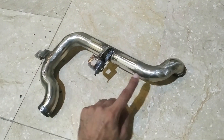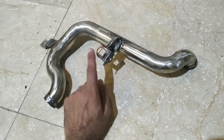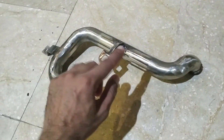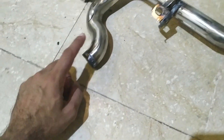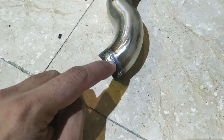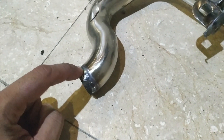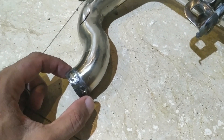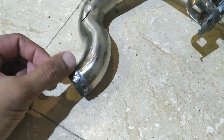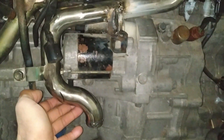Now let's revisit the coolant pipe that I made. I made two brackets which will help to mount it on the engine - one bracket on each side. This will ensure that the pipe does not move while the engine moves. At the corners of the pipe, I have put weld beads on it which will serve as a collar, because the pipe was flat and didn't have a collar. I have added these on both sides so that when the rubber pipe goes on it, the side of it will clamp on and ensure that the pipe does not come off. This is how the pipe sits on the engine - it will move with the engine and not move from here.